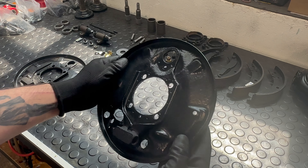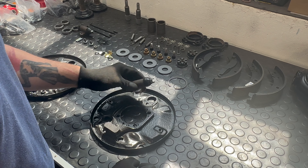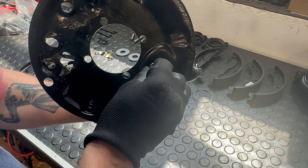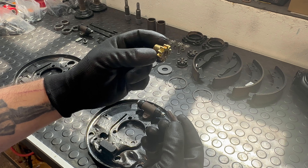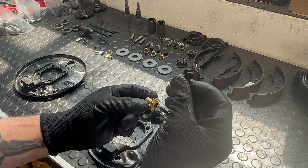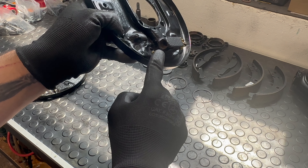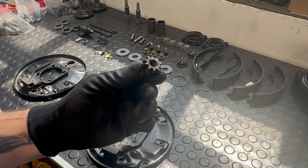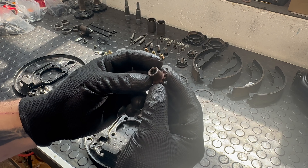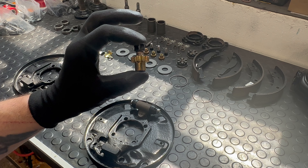Before putting anything on the chassis we need to assemble a lot of stuff on the workbench, so let's do that. Let's start with the backing plates for the drum brakes — they hold all of the parts for the rear brakes. First we will mount the wheel cylinder, which goes right here, and we will secure it with that bolt from the other side. Now the brake adjusters — this is a new piece, this bolt was cleaned and painted as well. They go into that hole right here, and there is another set that goes here. We will put a bit of grease in here and onto the thread, because look at that — this is the old one and I had a huge problem taking it out because of the rust. We want that to spin freely in the future, so grease is the answer.